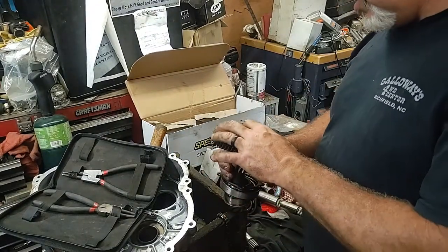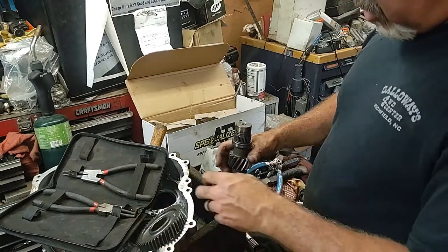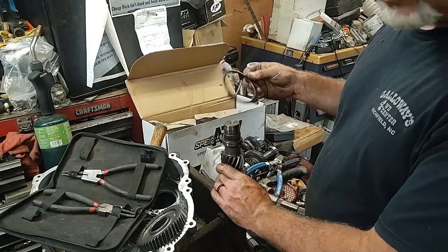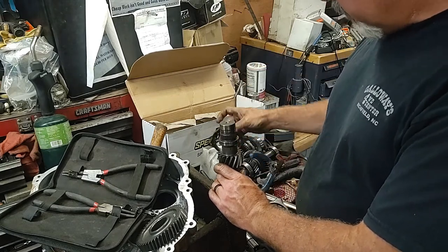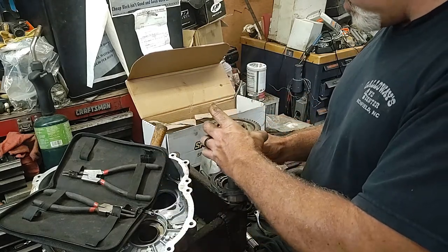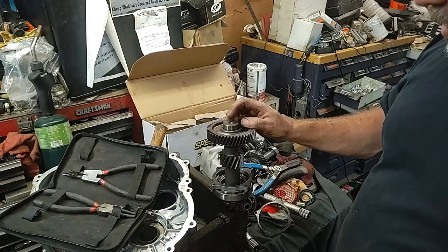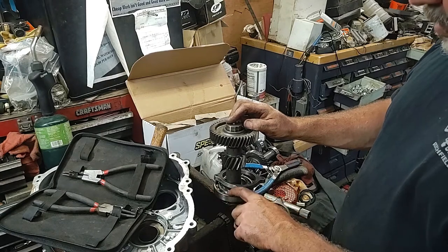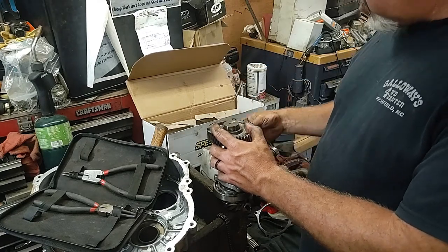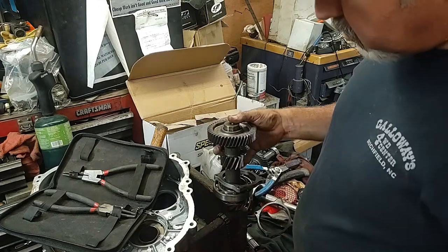Got the gear pressed off there. If you guys don't have a bearing separator to do this job, you might want to go buy one or rent one, cause it makes it a whole lot easier. And there's the crown jewel - that's what we're trying to get off, and this is the one we're putting back on. So now you gotta put all this stuff back together, which is probably going to require pressing it back, since all these were so dang tight. You're probably not going to have to take this bearing out like I did, but press this one on, put your washer and snap ring back in here, then press your bearing back on this end of the shaft and it'll be ready to bolt up.